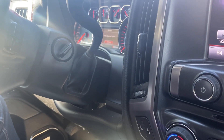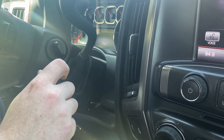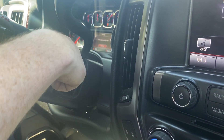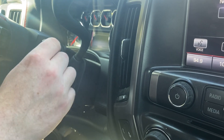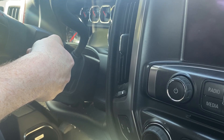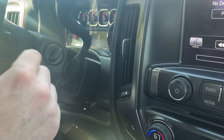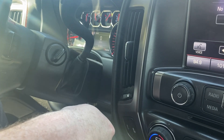Now we've reached our third and final 10-minute mark. So now we're going to turn our key to off, turn it to on, and now our key should be programmed. Let's go ahead and take the key out and start it to test. You might notice that when you first program in the new key, you almost have to start it for an extra second or two — hold it cranked forward.